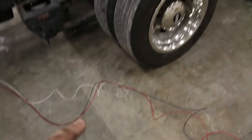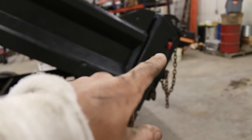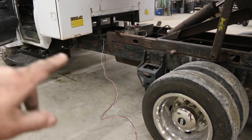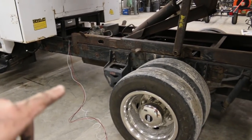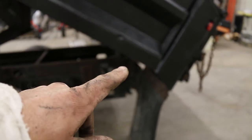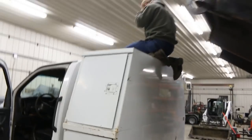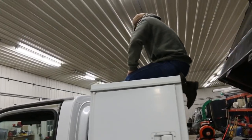So we've got to run a wire back to each wire that we have coming off this light. What we're going to do is I've already ran that up into the cab where our switch is going to be. I'm going to run these wires straight over to this driver's side light, and then we'll wire off of it after we make that connection and go over to the passenger side light. We're also going to have to run some of these up to the light he's working on now, which is the main strobe. So we're going to have two in the back and we're going to have this one up here that are all going to be connected.